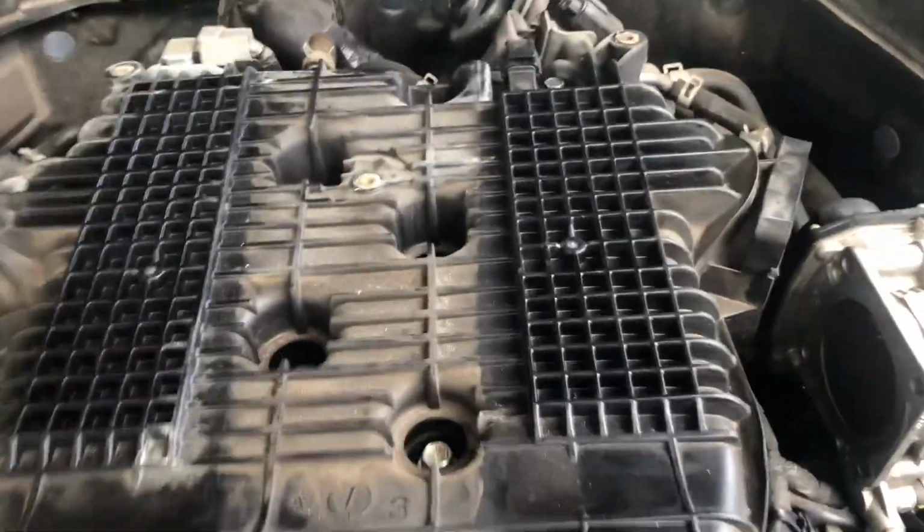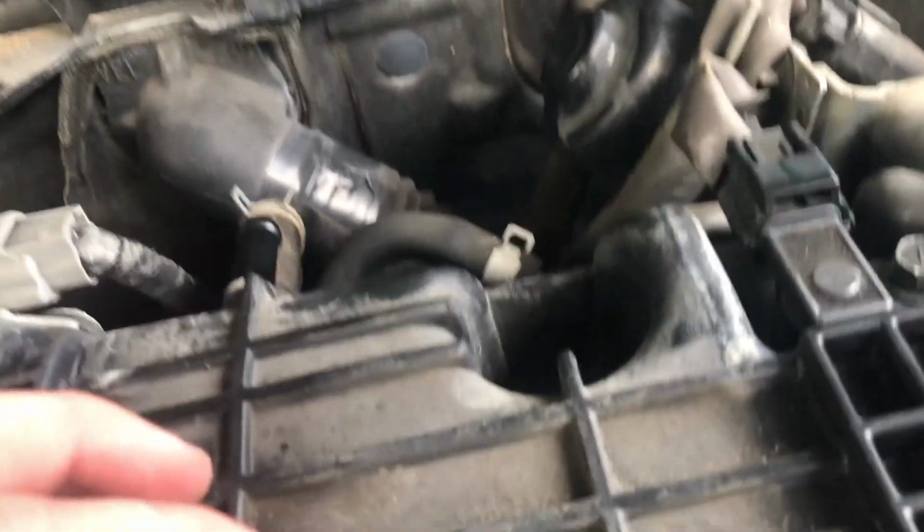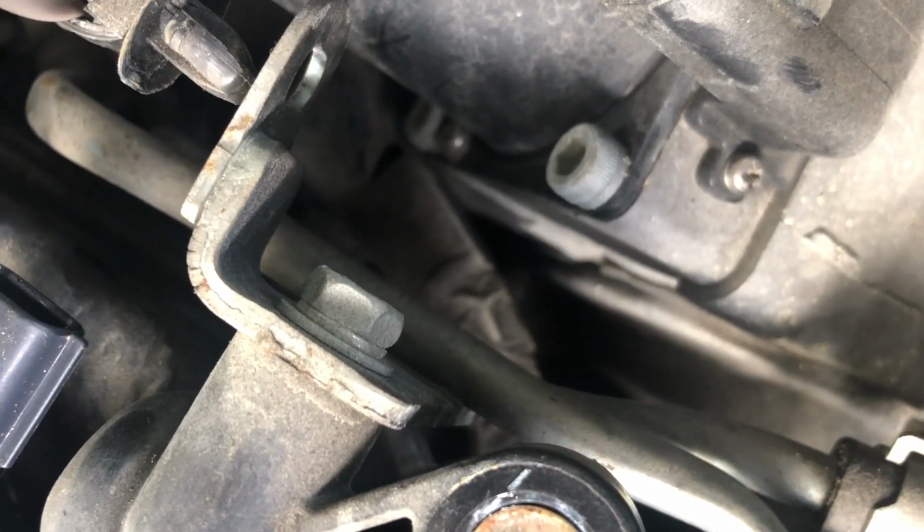So at least now it's moving a lot. Have to figure out what connections to remove in the back. It's definitely gonna be this one. Probably this one. This one. Remove those two bolts with this 10mm wrench, so we'll still be able to free that. Maybe here one more bracket, and same thing here, remove this one 10mm bolt.